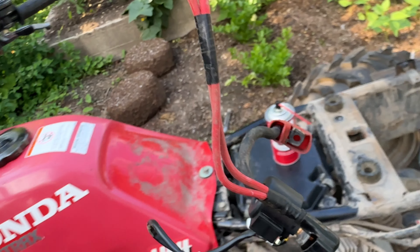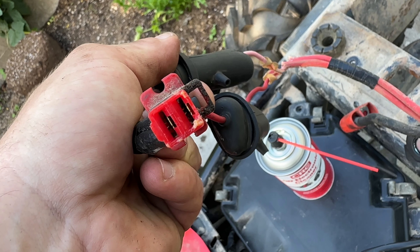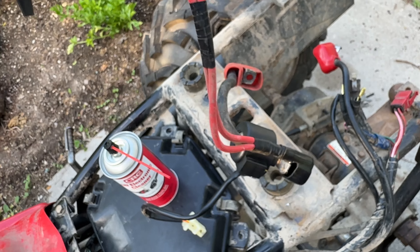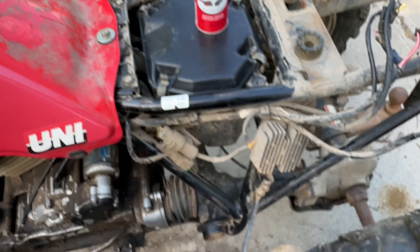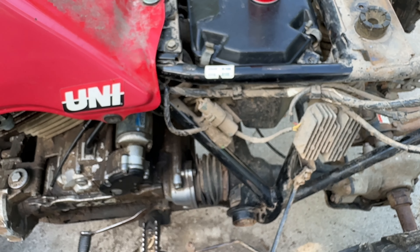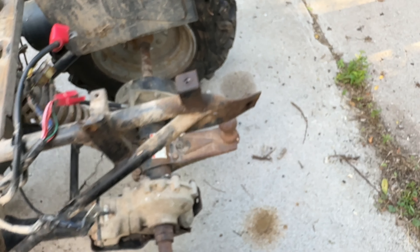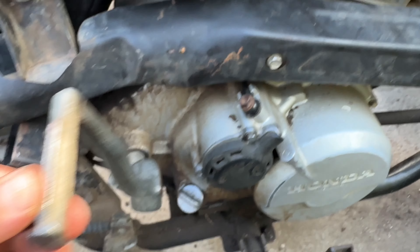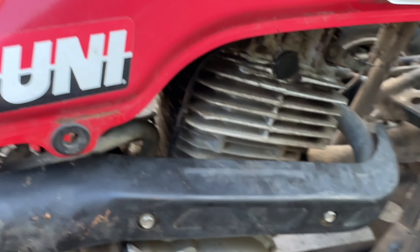The other cable that has the fuses — with the relay — I cleaned that out real good. I replaced the fuses in here. I can get the relay to click, so it's opening and closing. But I can't get the starter to engage. I don't know if the starter went bad or if there's a connection somewhere. I tried a few other tricks — sometimes there's a little bit of binding in here and you can click up the decompression valve. You can actually do it with your hand.